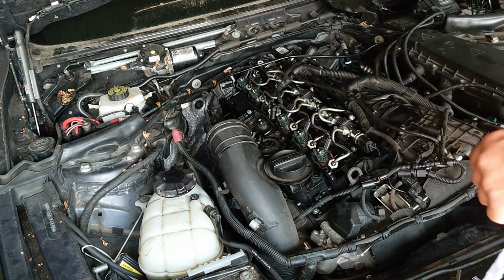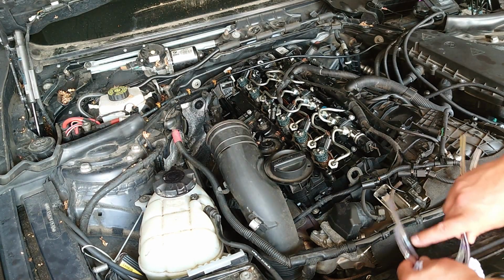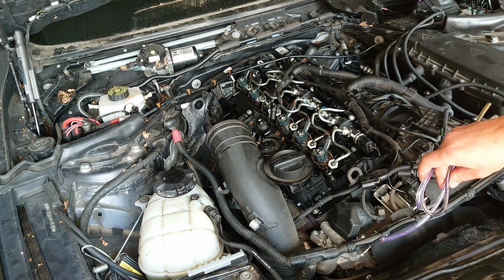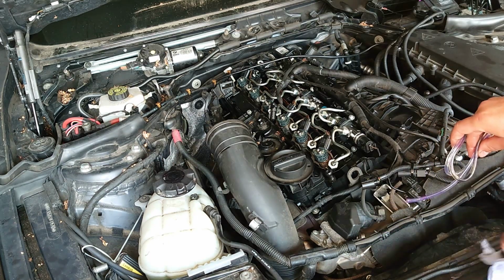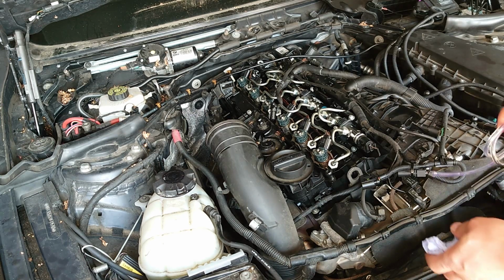Okay, so I hope this can be clear for some people. Just do the injector leak test and then have a look. It doesn't look like much diesel comes out, but it does. It's 5 injectors doing this, so you don't really gain any pressure whatsoever on the system.